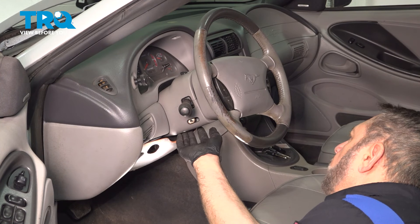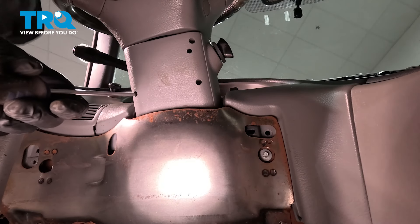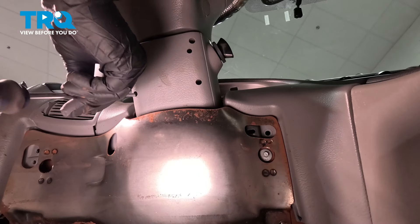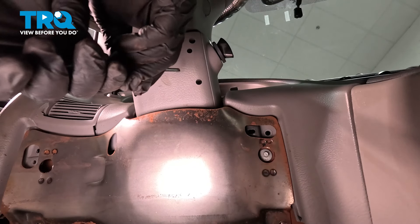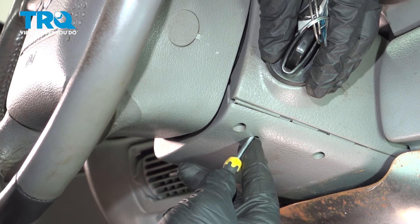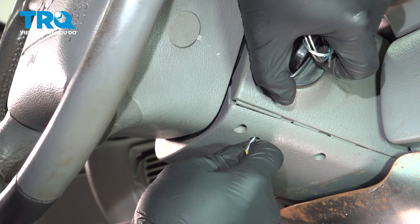On the bottom side of our steering column, we have this cover — go ahead and loosen and remove that screw. Now I'm going to use a small Phillips head screwdriver; you can use a pick or an awl. Insert it at a slight angle back — there's a button in there you're going to be releasing. Pull on the whole ignition key switch outward. This is the pin right here that you would have made contact with; pushing that in releases the lock. Go ahead and set that aside.